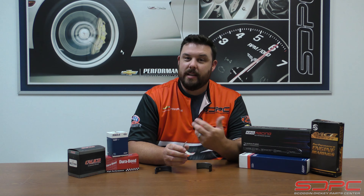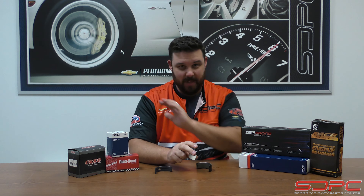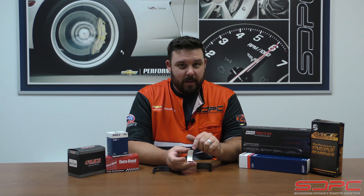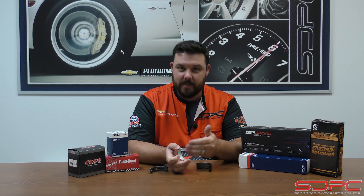The actual oil film inside of this while an engine is running creates something called a hydrodynamic wedge. While you might be seeing 40 or 50 PSI at wide open throttle, what you're actually seeing between the crank journal and the bearing surface is a lot higher than that. As the engine winds up with RPM, it creates a very high load film of oil. This is why engines are going to thinner and thinner oils and synthetics — the specification of how close the bearing diameter needs to be to the journal diameter of the crankshaft is a big deal.